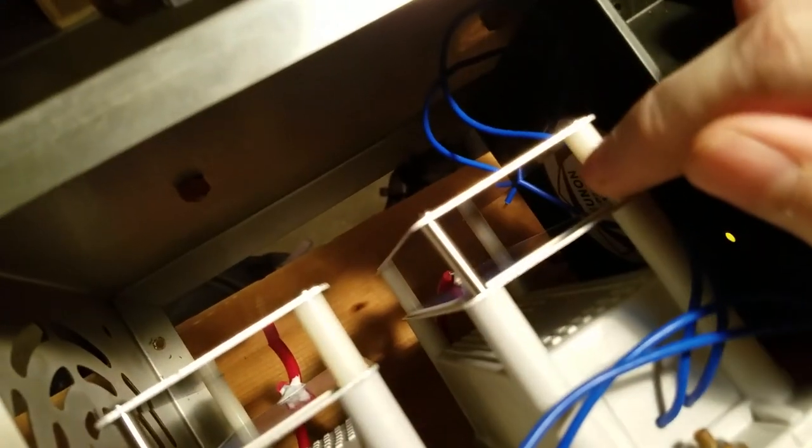Whereas you can see on this side, the three other posts, as compared to this one, are all plastic. So this is the only one that's an electrical connection. So the connection goes from this plate to that plate, from this plate to this plate into that wire, from that wire onto the other wire that's right beside it, connected into that same little white bulge. It's actually a piece of rubber, and apparently those two wires are both hard soldered onto the blue plate, and then they're covered with some rubber so the arc doesn't go anywhere else if you get your fingers close to it or something like that. But, yeah, that's the whole electrical connection. So up to there, up through here, over to there, back down here, and back down there, and into the transformer body.